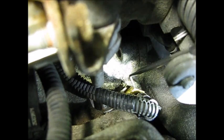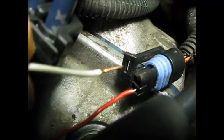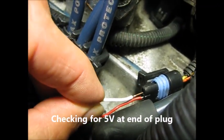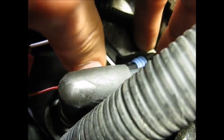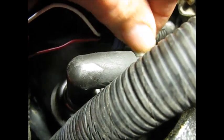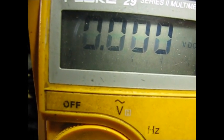I'm going to unplug the sensor. I've got a mirror in there and solid test wires — about 18 gauge — inserted into the plug. The ignition is off. I've got my meter hooked up on the other end of these wires. I'm going to turn the ignition on and see if we have our five volts. Ignition is on — that's proof that the correct voltage is at the end of the plug.